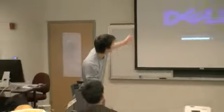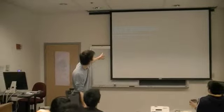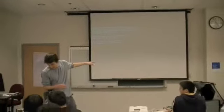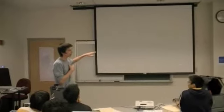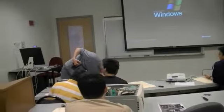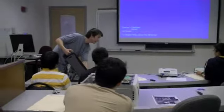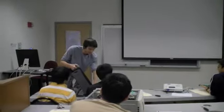So what you're gonna wanna do, this is what you'll see. Obviously there's nothing on the hard drive. That's fine. That's because the floppy drive isn't connected, I'm pretty sure. You're gonna wanna enter what's called BIOS. This is booting XP. Let me hit that again. If you had a brand new computer, there should be nothing on the hard drive. So hit F2 on startup.